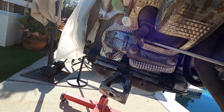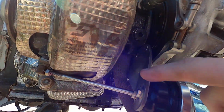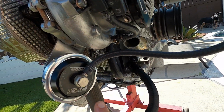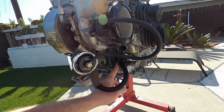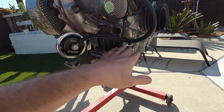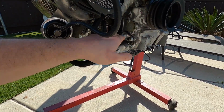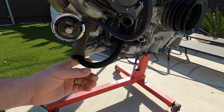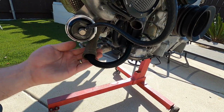But what I did is I took it, and this won't move, this is a heat shield and it's really tight in there by the wastegate actuator bracket, but I turned it to -8 and put this loop in it. The reason I did that is because before it had to make this really tight turn here, and it always kinked a little bit with the rubber hose. When I first tried to put the -8 fittings on here, I was putting it more direct, and no matter what shape I did, it was kinking. So here you can see this fitting's a little loose, so if I need to, I can rotate this down. I don't want to have it swoop down if I don't have to, so I'm thinking something like this.